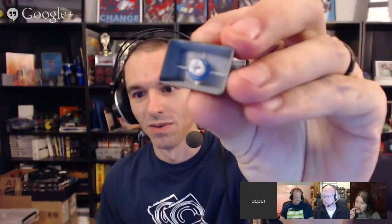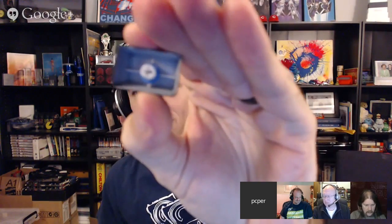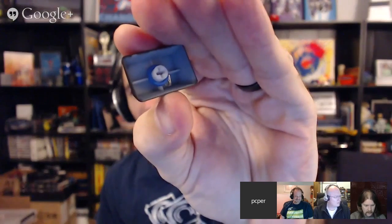And the idea is you put, let's see here, I will pull a key off of a keyboard. There we go. So you take them, and you put them right there. Camera will focus. So you stick them there, and the O-ring bottoms against the Cherry switch assembly itself, instead of the key bottoming against the bottom of the keyboard, making a harder sound. So it's just one way to silence your Cherry keyboard in case it's making a little more noise than you want.